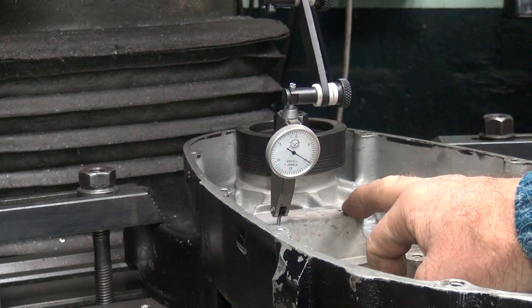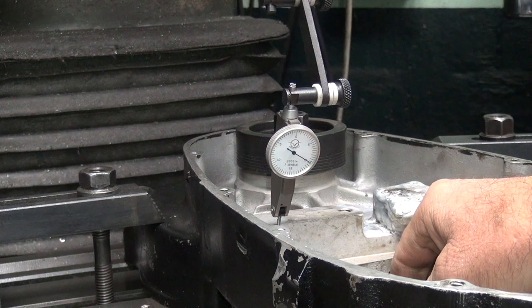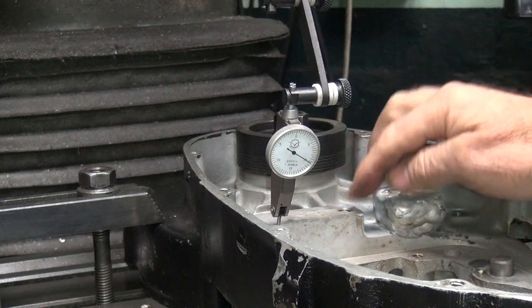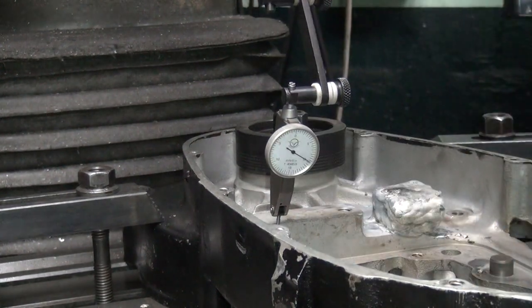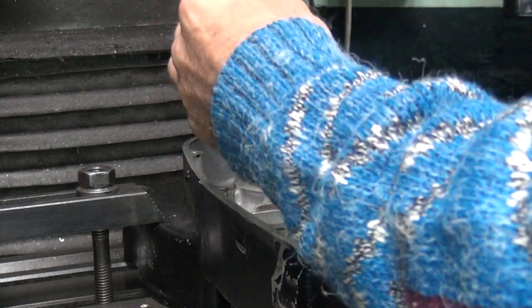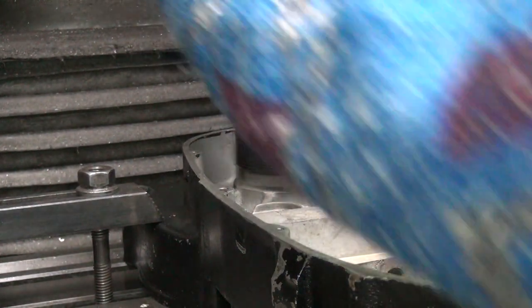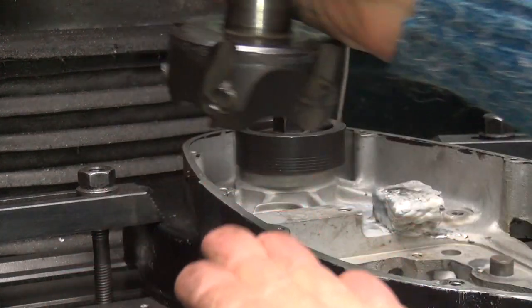Okay, now we gotta go ahead and center off this hole right here, figure out what dimension that is at, and then we can come off this from here. Now we can get the center this way by doing an edge finder. I'll show you how to use that. Or you can guess what the hole is just by putting a drill in the chuck and going up and down a few times. That one's quicker. That's easier how I do stuff. Quicker is always easier. But for now, we need to cut this down with a face mill and get it cleaned up. Just a face mill. Faces off the part like this.